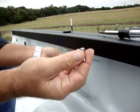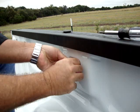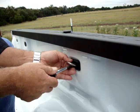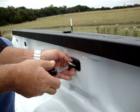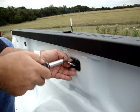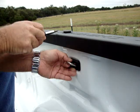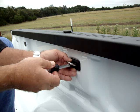At this point, grab your screw and drop it in. Now, one thing to keep in mind: if you're buying a spray-on bed liner, your applicator will probably ask beforehand if you're going to put tie-downs on your truck in the future. What you want to do is take these plastic plugs off and let them spray it. In the old days, it used to spray right over the top of these, which makes for a difficult installation down the road.